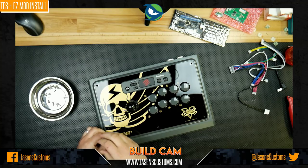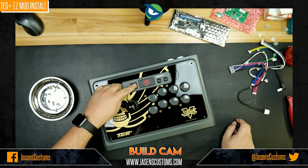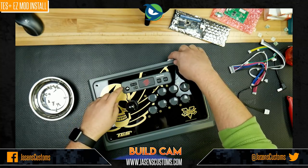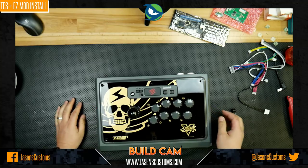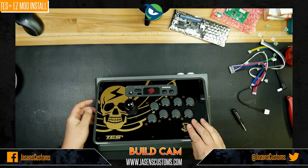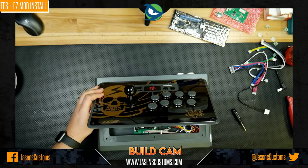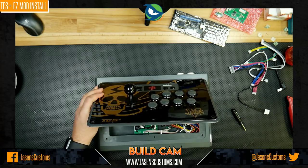Now, when this whole thing is done, your L3, R3 will work, your home will work, and your D-pad, left stick, right stick thing will work. The lock switch does not work, and there was a very specific reason I did that. Because you have to be able to hold start and select and do things to update the Brook board, it would have required more coding, a more complex board design, and hence a more expensive board. Because you can't really get into the stick super easily without taking this whole top panel off, you actually don't want to have some sort of second button on the EZ mod that you would have to use to do the Brook updates. So that button will not work.